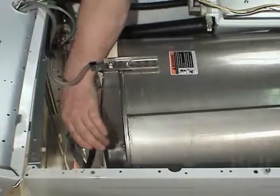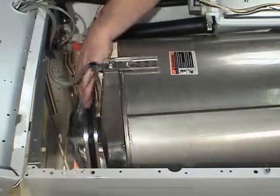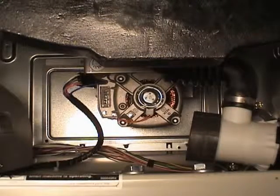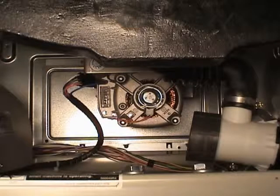Replace the belt on the motor pulley. Run the belt onto the pulley and rotate the pulley until the belt is properly centered. Adjust the belt tension if required. Working through the lower front of the washer, place locking pliers on the metal rod of the motor assembly and loosen the two adjusting bolts and the two pivot bolts. Pull down on the motor to increase belt tension. Use a Burroughs belt gauge to obtain proper tension. Proper belt tension is obtained when the belt can be deflected approximately one quarter inch from the normal position when moderate pressure — 50 to 60 pounds — is applied to a point midway between the motor and inner basket pulleys. After proper belt tension is obtained, tighten the belt adjusting bolts firmly, then tighten the pivot bolts.